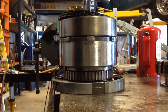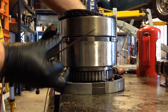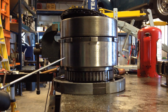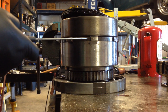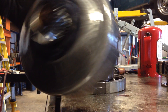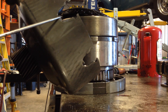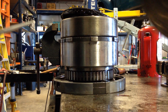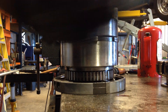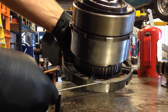We've got a few different things going on. This clearance issue here is because a thrust washer was omitted between these two drums during previous service. This drum is actually the wrong drum for this transmission — it's from an early model version of this transmission. That helps support this and goes over it.